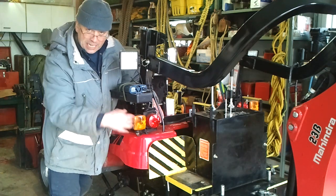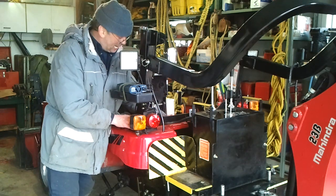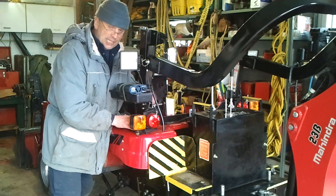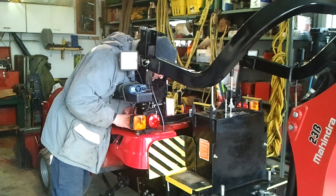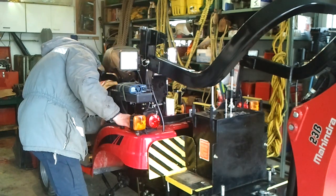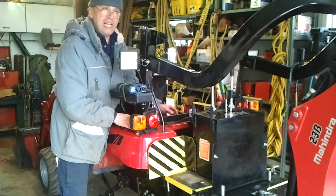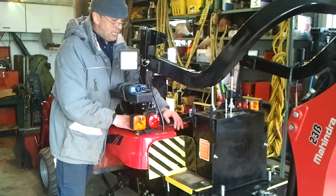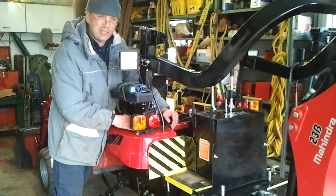It could be part of the addition of the strength about that, because there's a big steel plate here in the back. It's more than 1/4 thick, and it's related to those things there too. And I'm also looking, there's two bolts here on the top, which are holding the top of the transmission, so I will try to torque them also. And now there's only 4 bolts in the front. That's easy, I always torque them. So that's showing you the importance to read your operator manual.